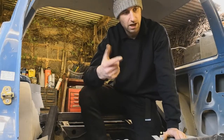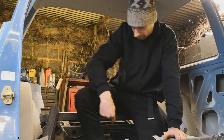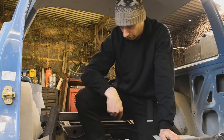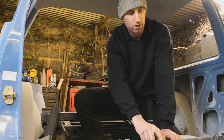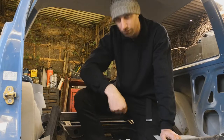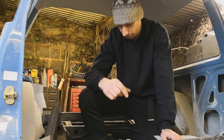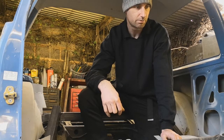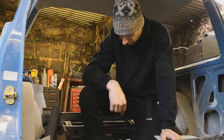Hello, welcome back. Today I'm gonna get the gearbox and the engine out, but first I'll put the prop in so I can check out the situation and get some measurements. I think I'm gonna send this and the other prop I've got off to someone and have two props made the right length for the job — all nice and serviced, ready to go. It just seems like the safest option, probably the best option rather than making a spacer.